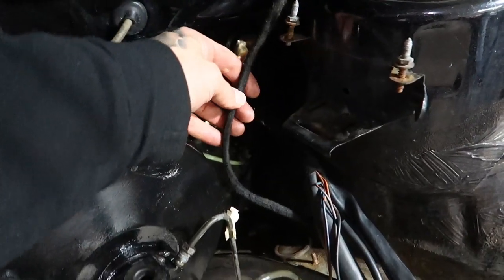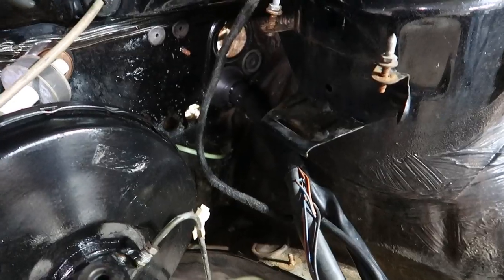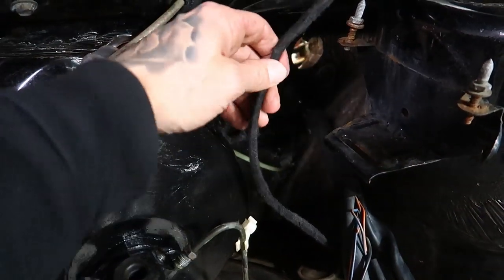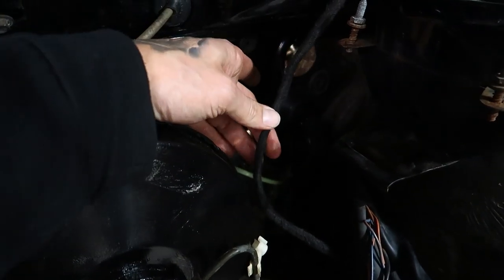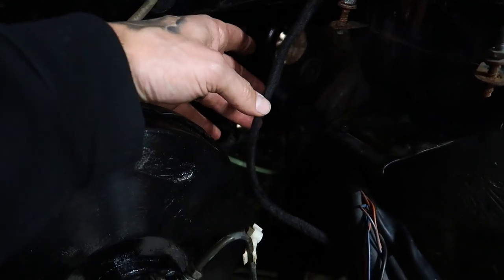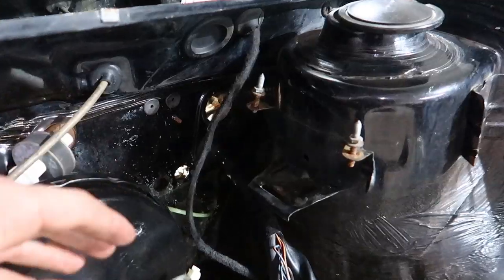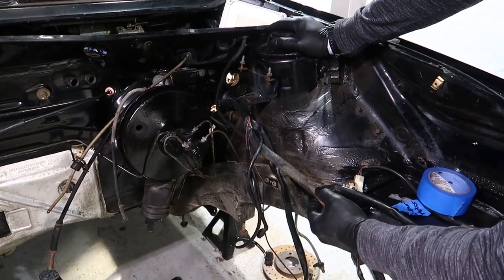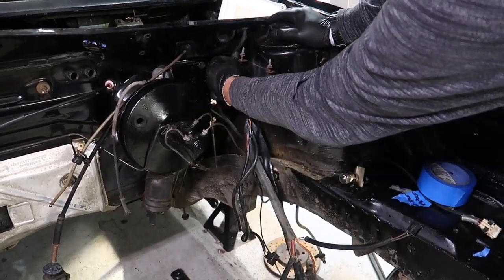So it's just body on the bottom, engine harness on top. So you saw Jeremy wrap this, and he wrapped it in with the original body harness. All my body harness now is in the bottom hole. This wiper motor was up with the engine. I just didn't want to mismatch it. I just wanted all my body stuff down below. Now I'll have the engine stuff just coming from the top. Sometimes it's easier. I don't like the way this looks. I like the way this fabric looks.